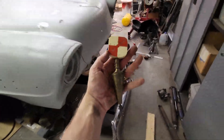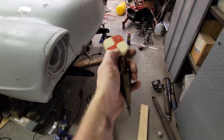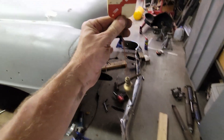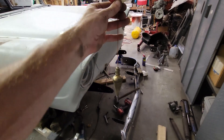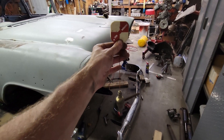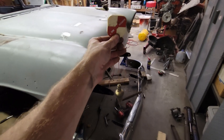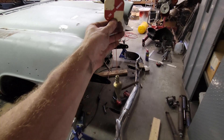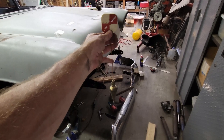Back in the day when I used to race dirt street stocks, I'd use a surveying plumb bob like this. You run a string line down, put marks on the floor, and use them to make sure your frame is square and your axle is square. I'm going to use this same technique — transfer marks to the floor so I can measure everything instead of working up in the air. Let me work on some benchmarks and we'll take it to the next step.